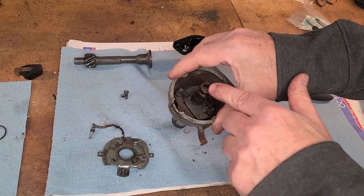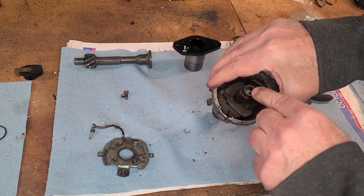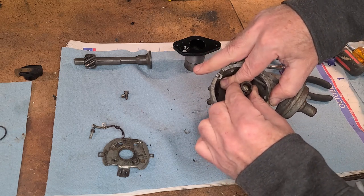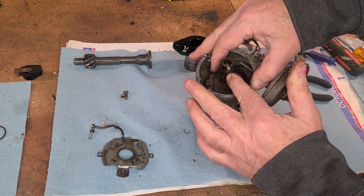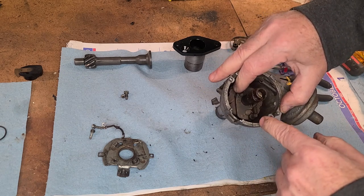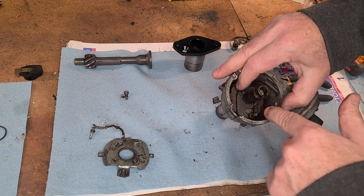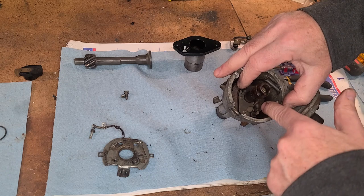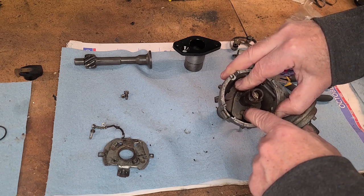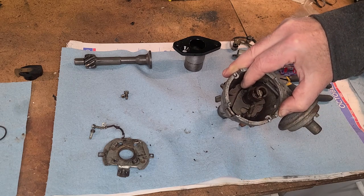That screw is not coming out. I could not get it to loosen and I don't want to strip it — it's just a flat screw. The only thing I'd accomplish by taking it off is to remove this outer sheath with the timing lobes and possibly gain access to the weights to clean them. So instead of taking it apart, I'm just going to clean it with spray — carb cleaner initially, then WD-40 or similar lubricant to make sure all the moving parts operate the way they're expected.